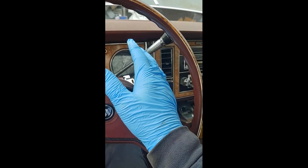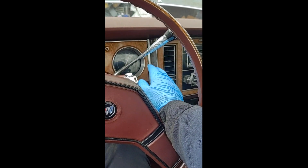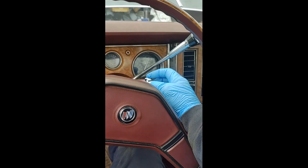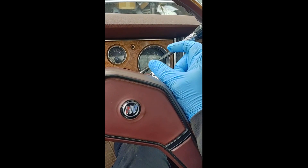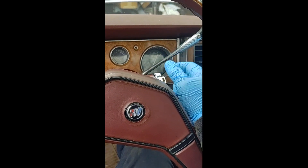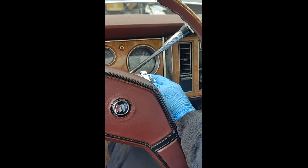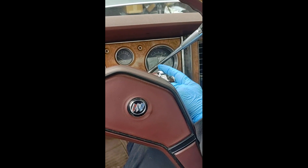The first time I actually drove it and floored it to pass someone, I guess it created a vacuum in the system from the demand, and it bent the push rod - the arm for the fuel pump. I ended up putting in a new old-stock harder one that had a little piece of metal on the arm to help support it and provide a wear surface. I feel the injectors were part of the problem.